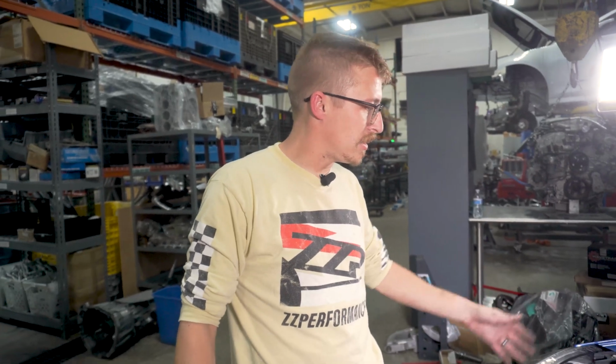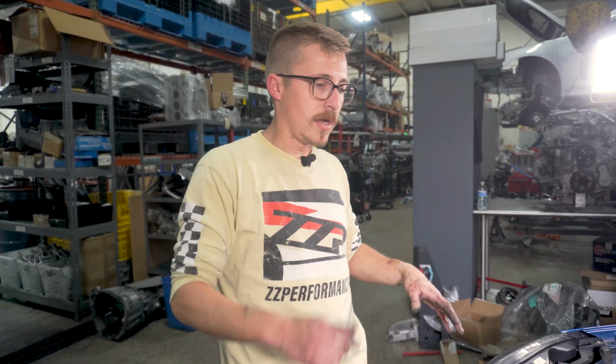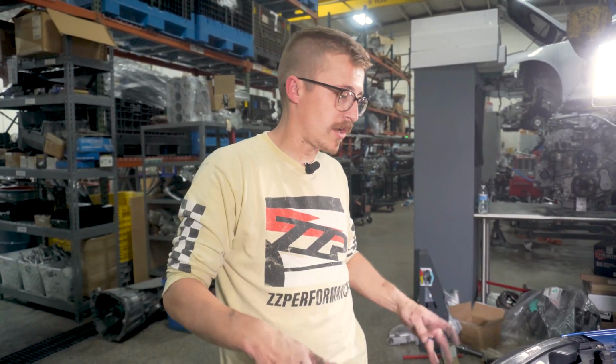Get your belt back on, fill your system. If you have a ZZP tune, click your key on, just to the on, but don't start the car. Check for leaks, make sure you're all good there.